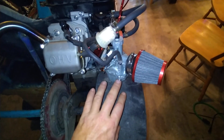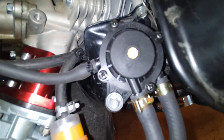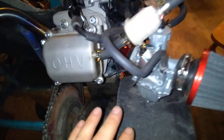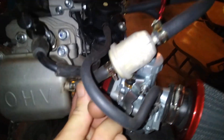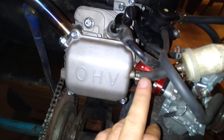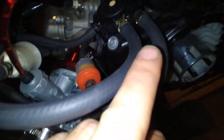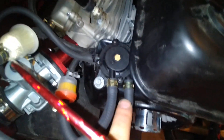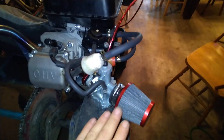Sure enough it'll run like a top. We added our pulse fuel pump here — these predator motors actually already have a spot for it. Even before my pulse pump, I added this filter just because I don't want to leave it open, but I can actually use that as my pulse to pump my fuel, and it all works perfectly.